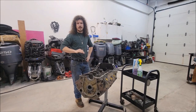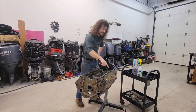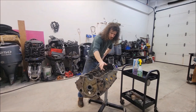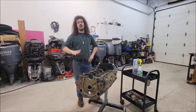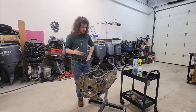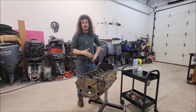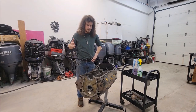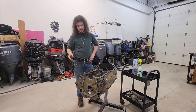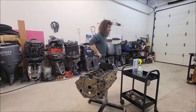For now I just want to start with the exterior and get all that oil off. You can see it's pretty bad in certain spots from whatever they did at the machine shop. We want to get this nice and clean so that the paint will go on. With paint work, it's all in prep — the cleaner the block is, the less chance that the paint's going to chip or flake off. We want good adhesion, so we're going to try our best to achieve that.